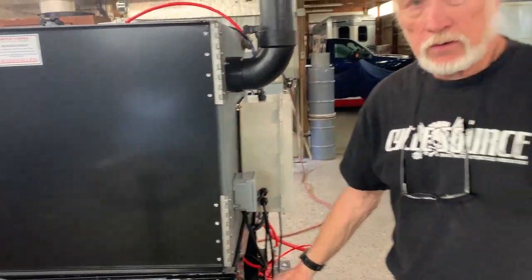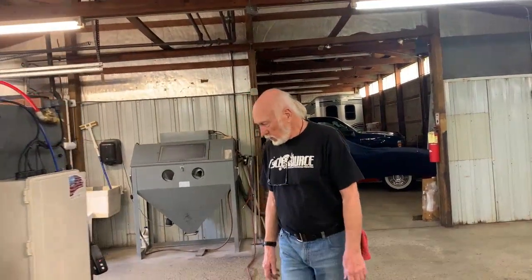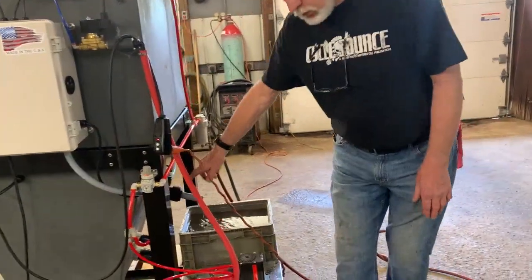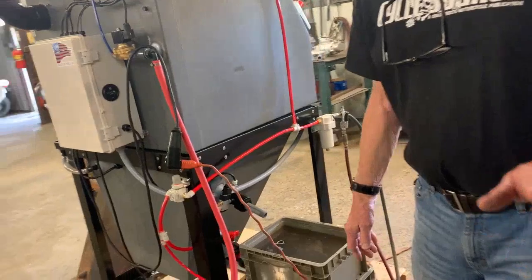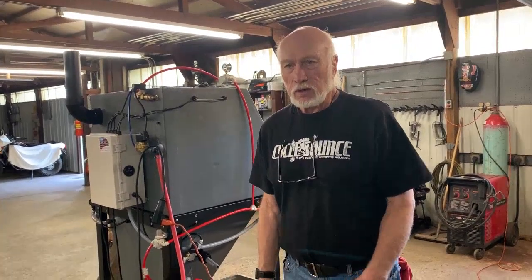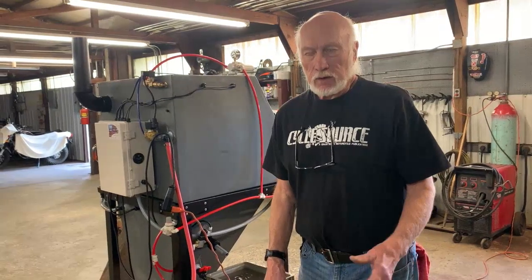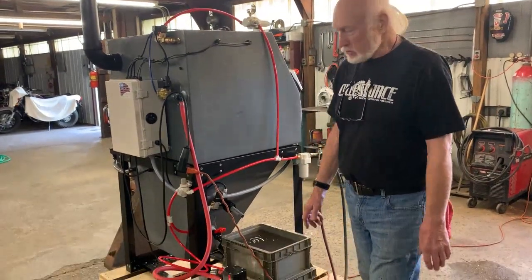It's just an atmospheric vent — no water, no debris. When you open the door, water and debris will drip off the door right into the tank and be returned. One thing that's very important when you get one new: water first. The instructions will tell you to fill it up to a certain level and show you clearly where the drain comes out. Water first, then dump in your 25 pounds of media and it will mix clear. If you dump the media in bone dry and then add water, you'll have a time waiting for the sludge to move. Water first — always.